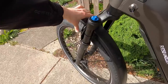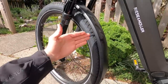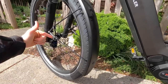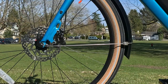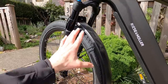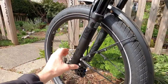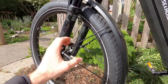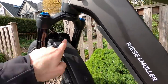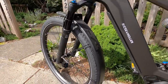These nice 65mm plastic SKS fenders are really well supported — two support arms under each fender, compared to some designs with adjustable silver rods that get bumped out of place easily. This is the way to go. Even here they had to compromise a little: there's a plastic clamp around the fork lowers that can slide up and down to adjust the tire-to-fender clearance as the suspension compresses. It's very custom and they did the best they could.